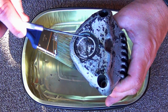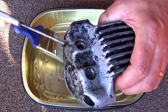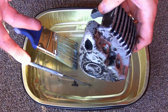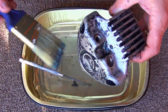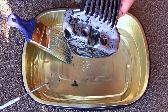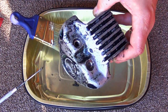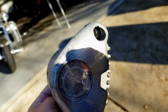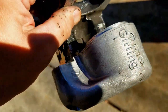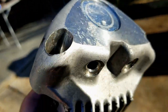It's coming off — look at that whole big glob that just came off right there! You've got to love this aircraft paint removal. I'm not going to record every single application. I'm just going to keep putting it on, brushing, scraping, and picking until I get this half done. That's three treatments of the aircraft cleaner, and then I hit it with brake cleaner to knock the residue off.